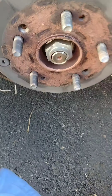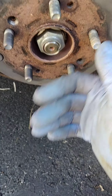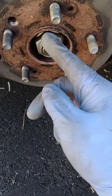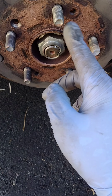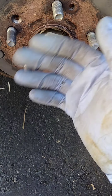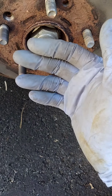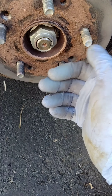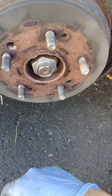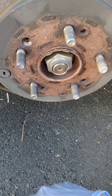One big tip: when I was removing these tires, I was able to remove them without even hitting them. A lot of people have their tires seized to the vehicle when the vehicles are very old. What you can do is get yourself some anti-seize — I believe this is copper anti-seize — and you just put it all over this area here. When you put your rim on the hub, it will not get stuck, so you can just remove it every single time. Nothing gets rusted or stuck together. You can always find that at any auto parts store.